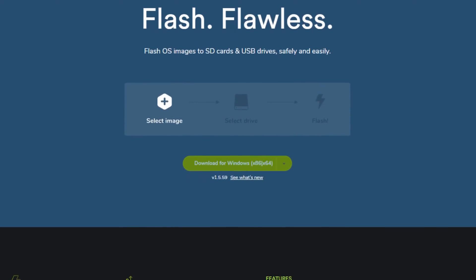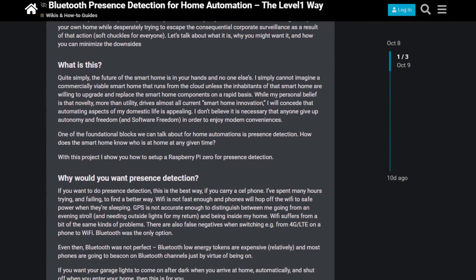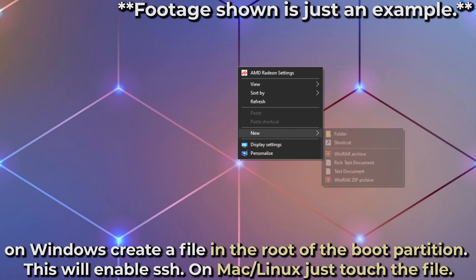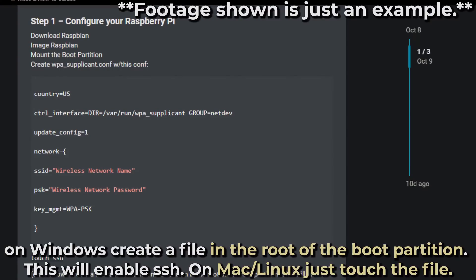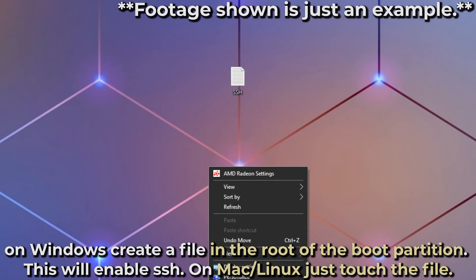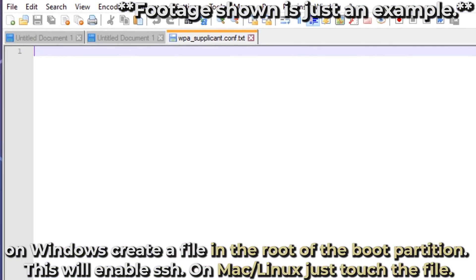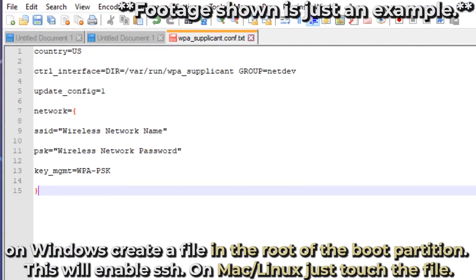If you're on Windows, you can use something like Etcher to etch your Raspberry Pi image. There's a full guide on the Level 1 forum, step-by-step for what you need to do. You'll create an empty file called SSH with no extension — that will enable SSH. Then you can create a file called wpa-supplicant.conf. Put your wireless network name and password in there. Hopefully you didn't make your wireless network name something absurd with a lot of spaces. FBI surveillance van is not really super hard to type in, but if you've got EliteSpeak or hard-to-type characters, you've just punished yourself.